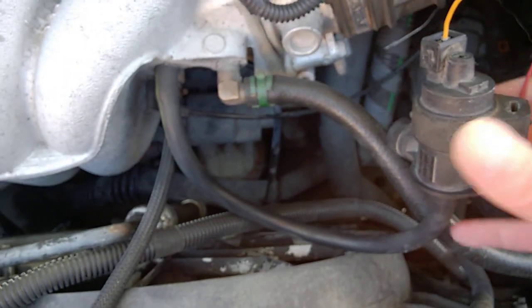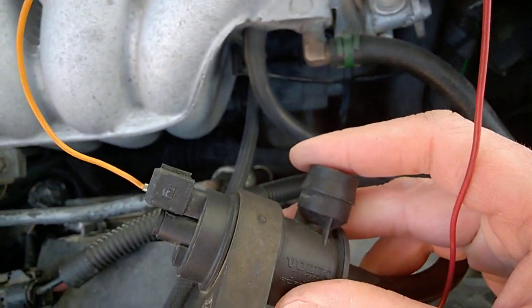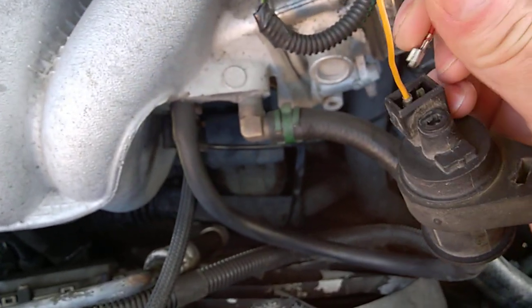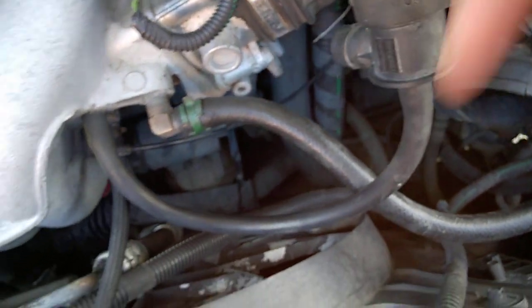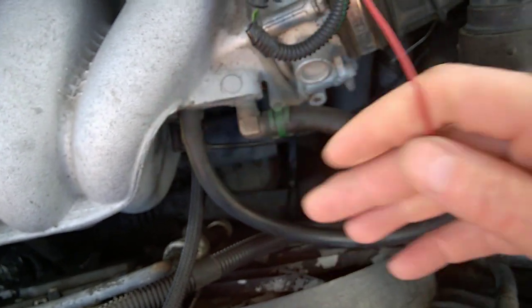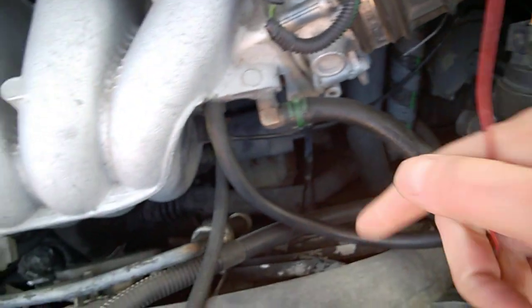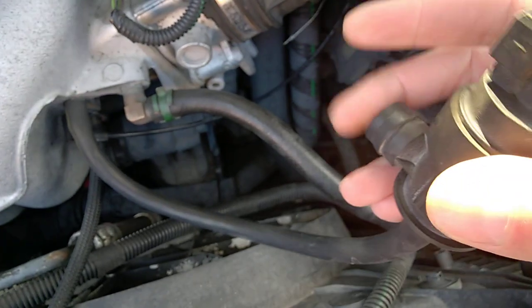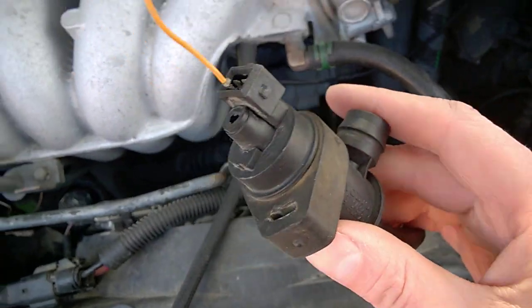I'm not going to demonstrate because I don't have three hands, but when you detach the fuel side hose and connect the two wires — when it's open — if you blow air here, you will hear it passing into the intake. When it's closed with no power, if you blow air, nothing is going to pass. Try using a small piece of paper rather than putting your mouth directly where the gas is, because it's a little bit not safe.